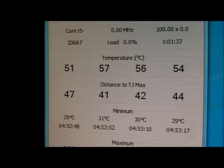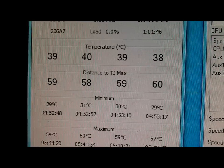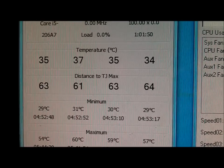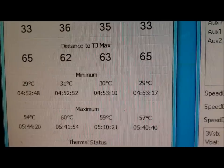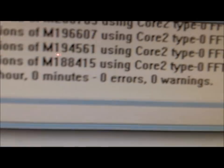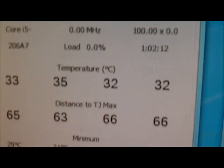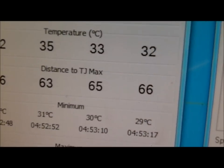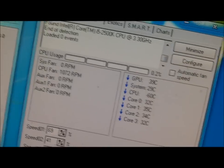Now we're going to watch how quickly the temperature goes down — I'm stopping Prime95 right now. It's pretty impressive how quick it dropped down to the mid 30s; that's what a good heatsink will do. Zero errors and warnings across the board, and we're back down to 1.6 gigahertz on not even a volt of power, averaging mid-to-low 30s Celsius. That is the CPU test for the Zalman CNPS9900 with the Zalman Super Thermal grease — I'll have more soon.